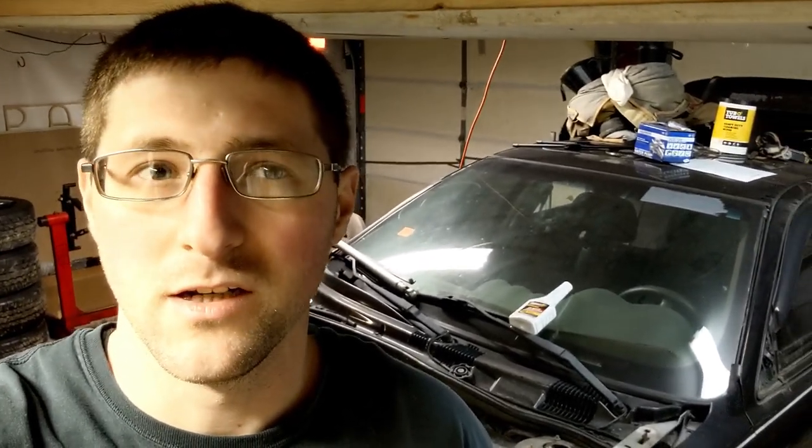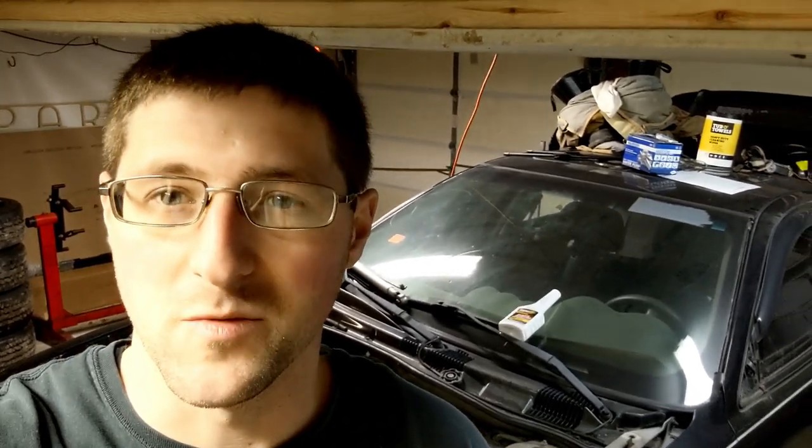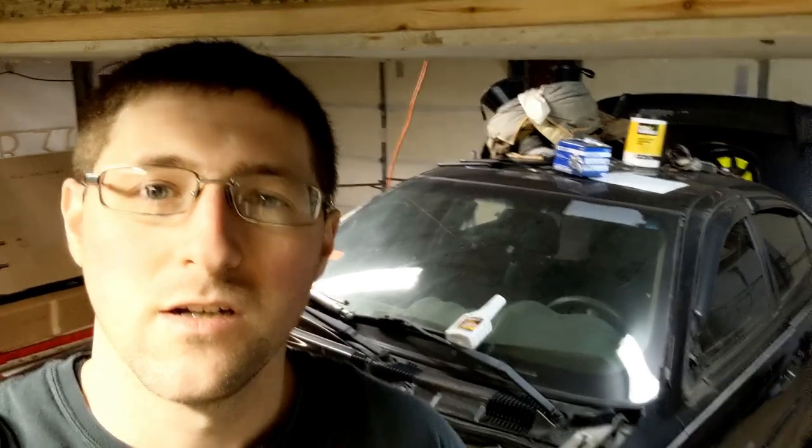Not a big deal. Pretty simple job, whether you're going to throw some stock ones back in or upgrade to aftermarket. Little note, 4x6s are for the front, 6x9s in the back. You can work with the Monsoon systems. There are wiring diagrams out there if you get lost. Find me on social media and I could probably get you the diagrams you need. For example, the back speakers will have two sets of wires running to them, highs and lows, so look at the diagrams and figure out what's what so you can tap into what you want.